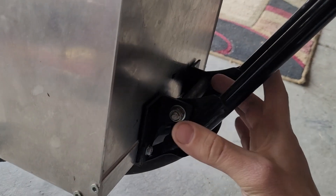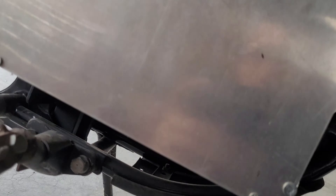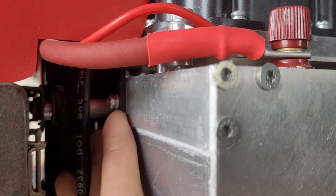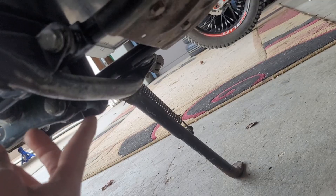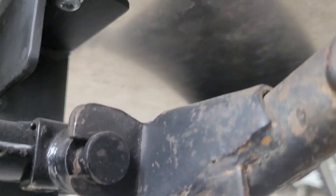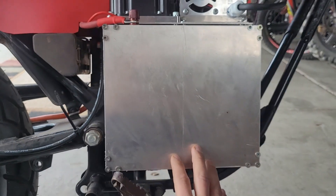To mount the battery box, I used the original engine mounts and welded together some angled brackets for it to rest on, then screwed it in. Up here I made a special bracket off the airbox bracket, screwed directly in. For the last mount, I used another original engine mount with a bracket screwed up and under — so I had three points of contact. The only modifications I had to do directly to the frame were right here: there used to be another mount, and I chopped it flat for clearance so I could fit the battery.